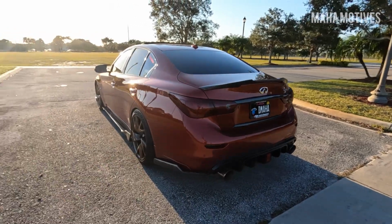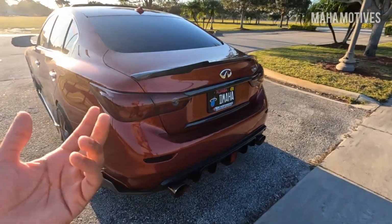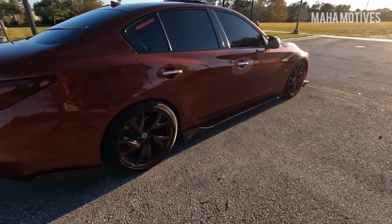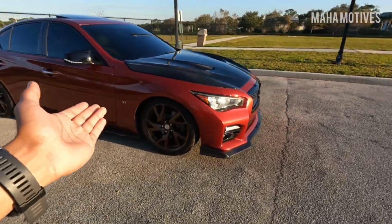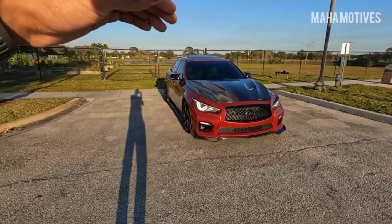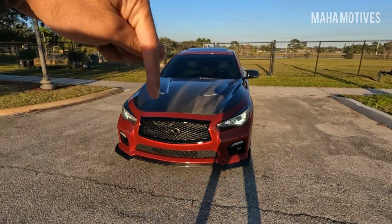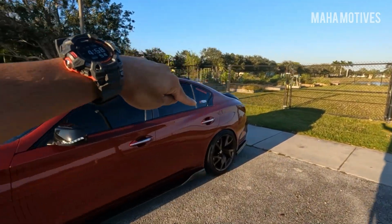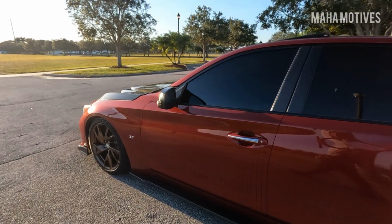But yeah, man, like I said, perfect example, my boy pulled up here just now. But again, if you're trying to be cost efficient, then just do a muffler delete. Most cars, it should sound decent. Just don't delete your resonators if you have a 4-cylinder or even a VQ. They sound very, very raspy, so I wouldn't recommend that. The resonators are the part that actually saves us from that rasp. Unless you have a full exhaust, because I don't have resonators on this exhaust, but it's a full cat-back exhaust from Arc Performance, I will link them down in the description below. Shout out to Arc Performance, that is their little logo right here. But honestly, that is the exhaust I'm running, leading to the resonated test pipes, Burke test pipes.